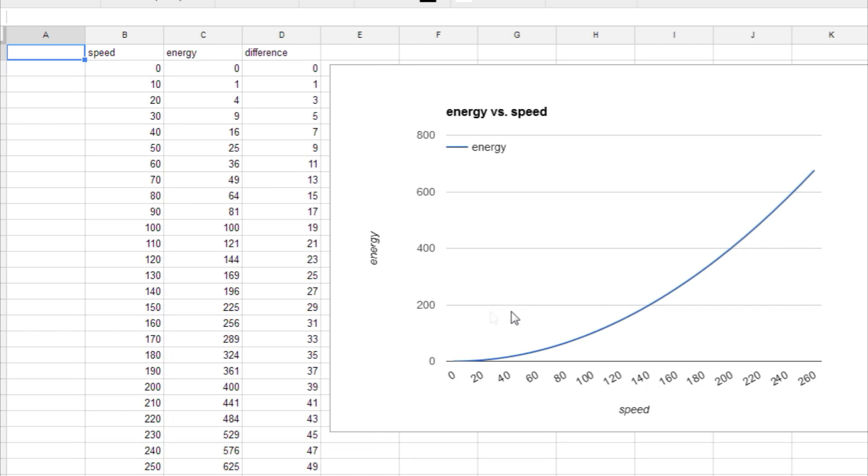So what does that mean for regenerative braking? At higher speeds we have a lot of energy available, and as the speed decreases we have less and less available. It also means the rate at which regenerative braking is applied needs to be adjusted to the speed. For instance, if we apply regen at a rate of 50 units per second and we're driving at 100 units of energy, within one second we decelerate to 70. But if we apply that same rate when we only have 49 units left, within one second we'd go down to zero. The regenerative braking has to be adjusted to speed to feel consistent in terms of deceleration.